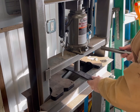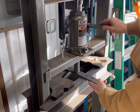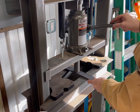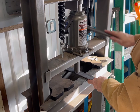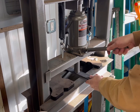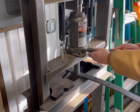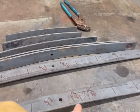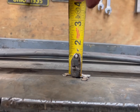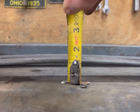That was 10 pumps there, so I can move on to my next section. Do the same thing - 10 pumps. I went a couple of times through the press here. On this pass, we started at inch and three-quarters in the center, and we're down about another half inch to about an inch and a quarter. So I'm going to go ahead and repeat this for the other shorter leaves, and I'll put the spring pack back together off camera and show you how much lower we can get this spring.